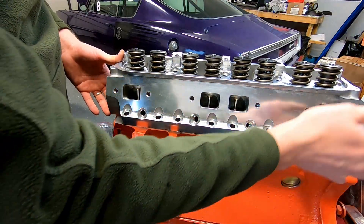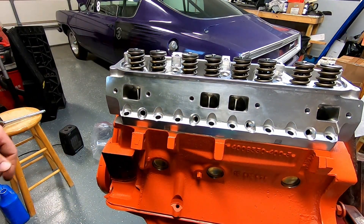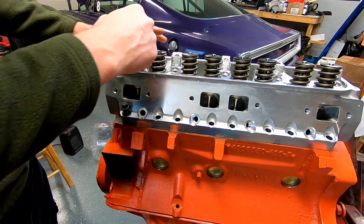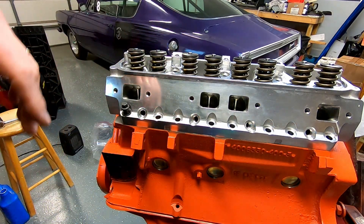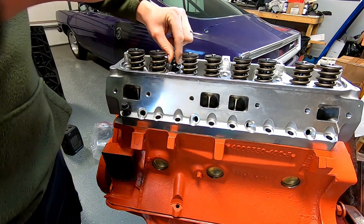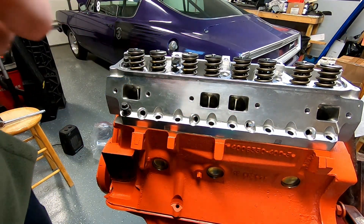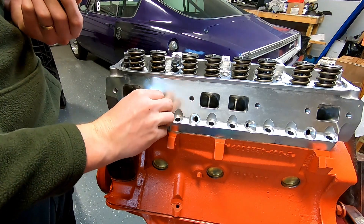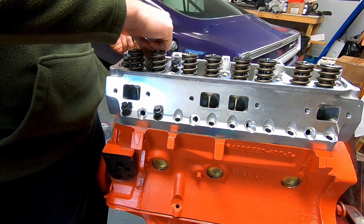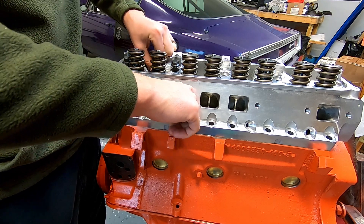I'm certain that it's flat against the deck all the way — I had to pop it earlier to make it settle in. I've got my bolts and I'm basically going to bolt around this chamber. I'm not going to overly tighten them or anything. This is just a mock-up deal, but it's good to know the process. We can check quench without having a push rod in place. If my push rod that I made bends, then it is what it is.